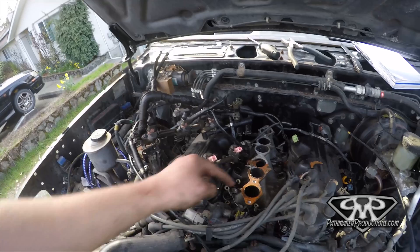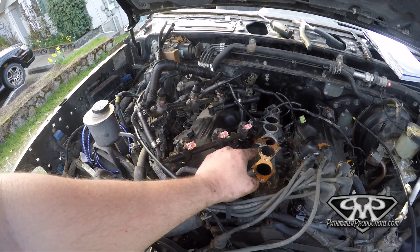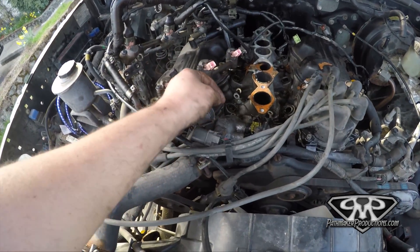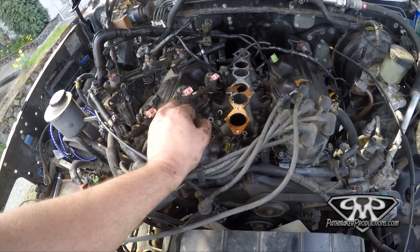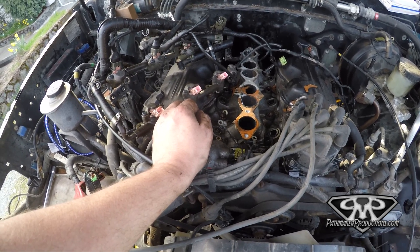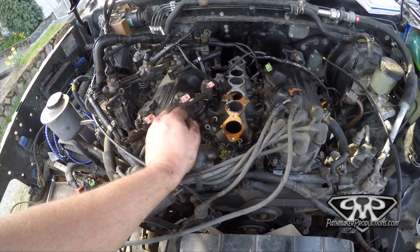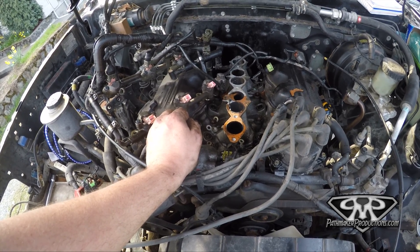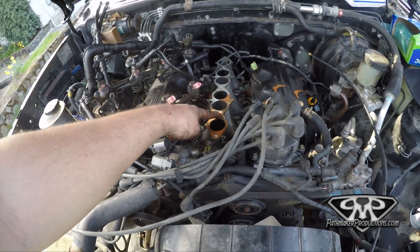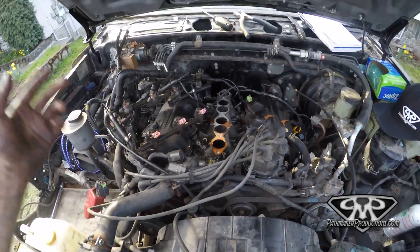The intake's pretty much off. I gotta pull the intake manifold off, cause this one looks way different than the TBI one. They've got four Allen key bolts and four 10 mil. Pretty much everything's been 10 mil so far, spun out pretty easy. When you pre-soak everything, it usually comes apart pretty decent. This is the last piece I gotta pull off here, then the distributor comes out, and into the electrical stuff.